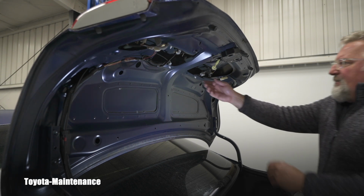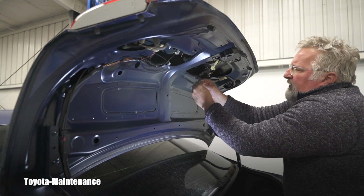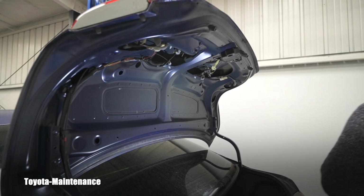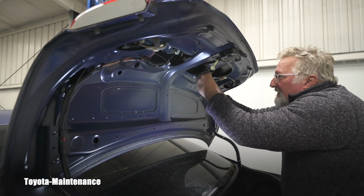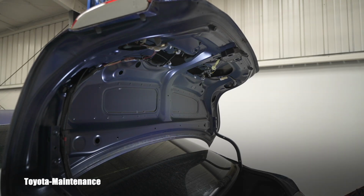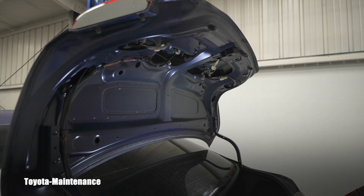So as I said, be careful, don't squeeze this too hard. It's good to slowly wiggle it there and back, there and back, there and back. Put a new one in. Just for our satisfaction of the video, we can put the lights on again to confirm that it's running before pushing it in. And now we see it was not the wiring harness. It was actually the bulbs itself.